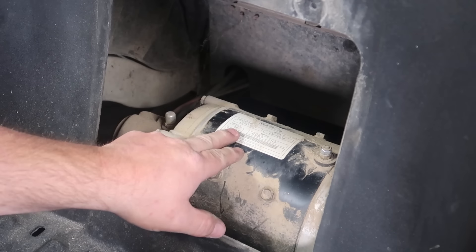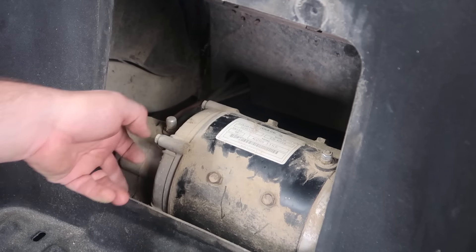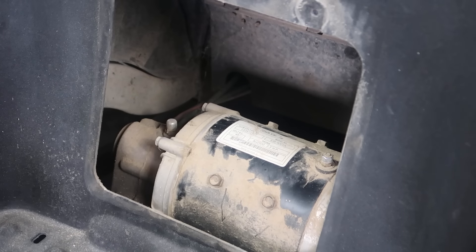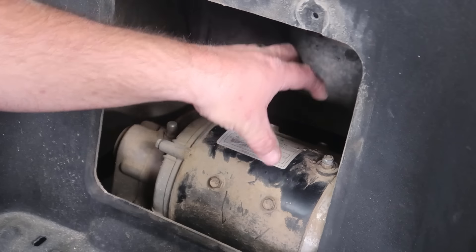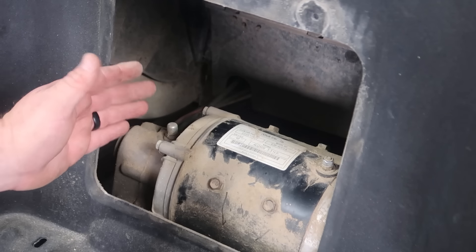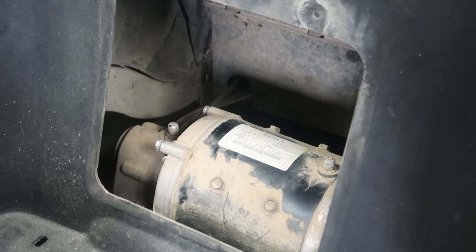What's holding the motor onto the axle is going to be three bolts — there's one here, one here, and one just off camera. It's going to take a 7/16th inch wrench to remove those bolts. Note that this motor is very heavy, so it's not just going to unbolt and pop right off. There's a shaft and we're going to have to slide it off. Once you have all the bolts loose, go ahead and remove them by hand.